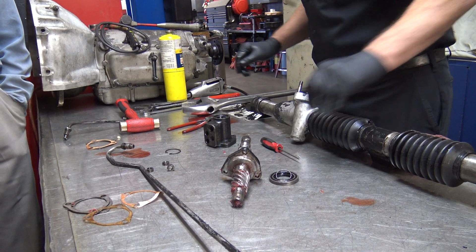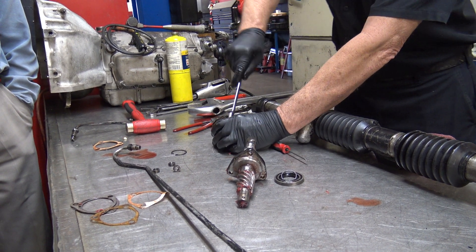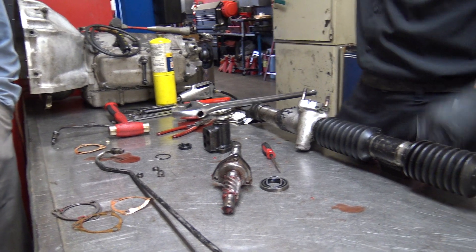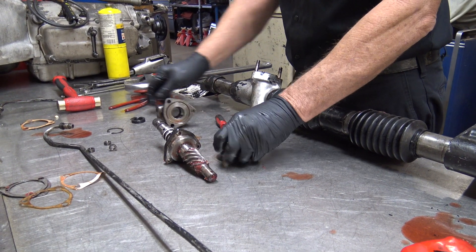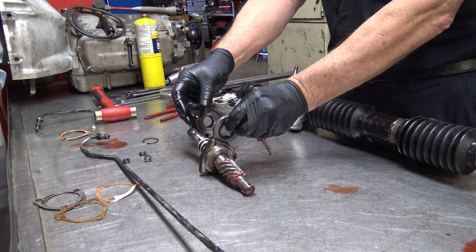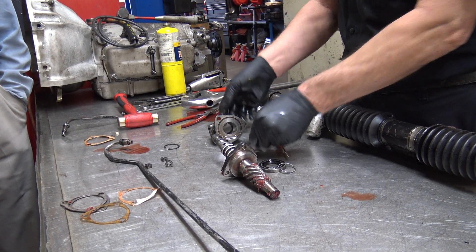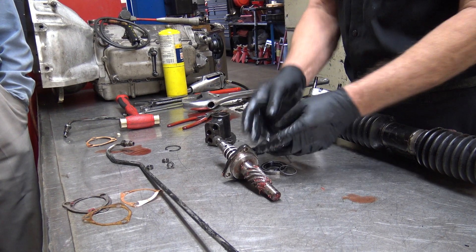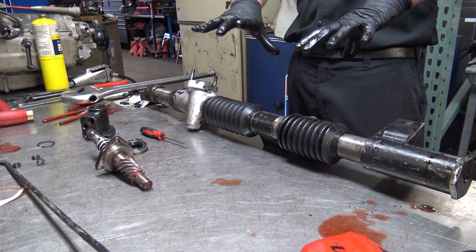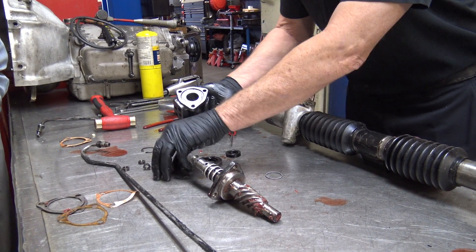This is kind of a compartmentalized unit in many ways. Our shop is in disarray right now because we're moving things around. For the high pressure fluid, all the directional control on this part of the rack is held between these two spots. When it leaks — if any one of these seals leak — it's either going to leak out the top, which is pretty visible, or it's going to leak internally past this seal down into this section, and that's what will fill up these. There is a lip seal, and there's an O-ring that seals up against this.